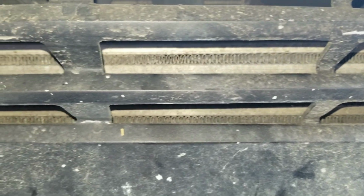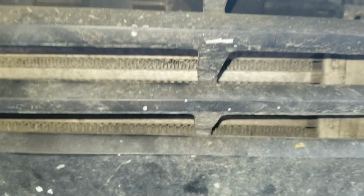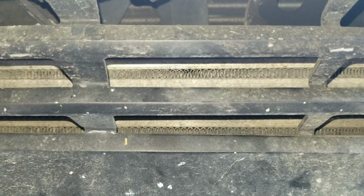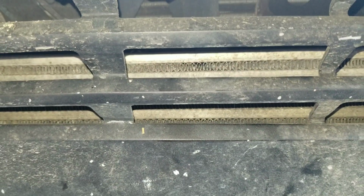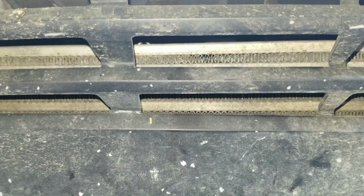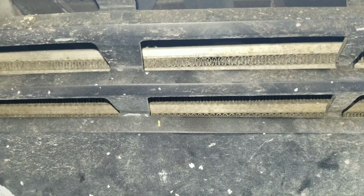Because, as you can see here, the tubes between the fin rows are actually about as high as the fins themselves. You only get 8 rows of fins there, and the fins are the available heat dissipation area for creating heat rejection from the frontal airflow of the car. So because the fin area is reduced, you get limited heat rejection in this type of an intercooler, and you need a big surface area to compensate for all that surface area that's taken up by the tubes running across.